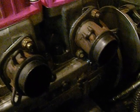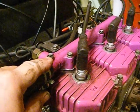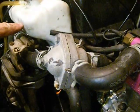We put our water pump housing back on, our jacket back on, and our little manifold back on with our gasket, and we are absolutely leak free now. I filled the reservoir back up again and cracked the little bleeder screw so you can let the air out, then fill your bottle up to where it says.